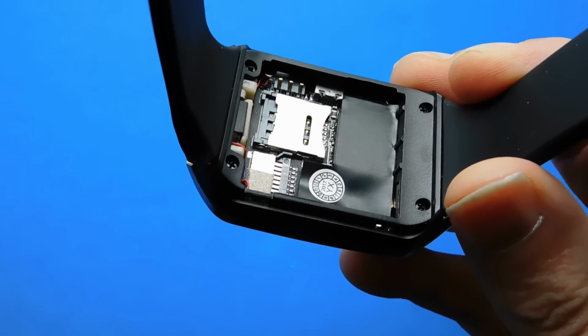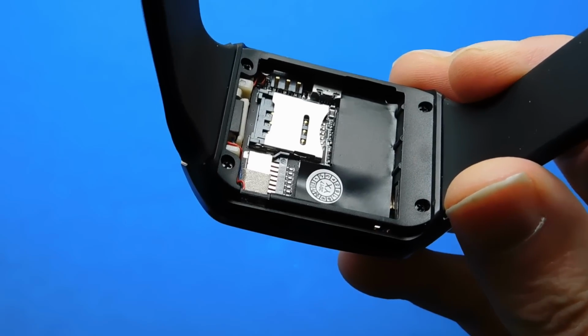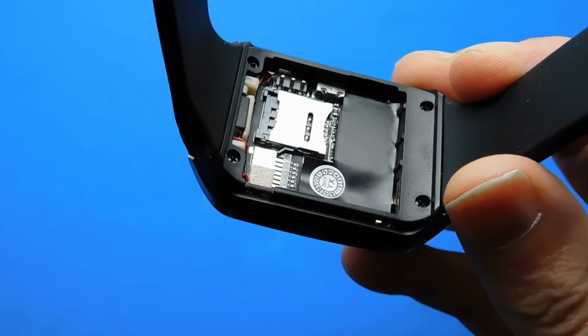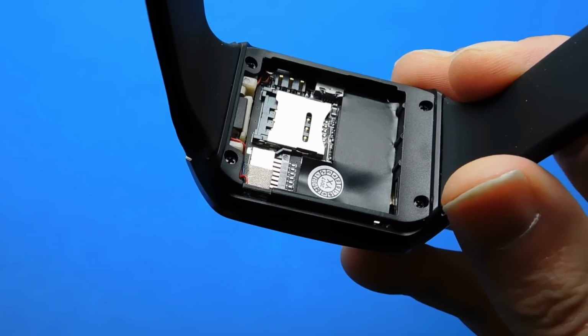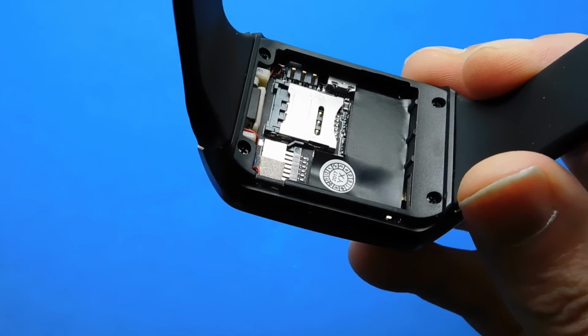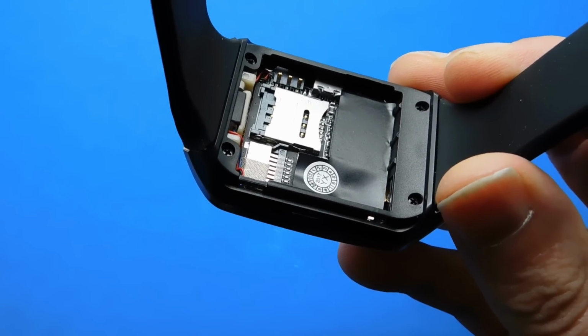At the same time, get the power button back in its hole and feed the charging port to the other side. Then you need to wrestle the straps back in on the pegs and put the cover back on that holds it all together. Basically, unless it's broken and you have nothing to lose, do not take this watch apart. I was lucky, you may not be.